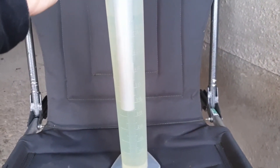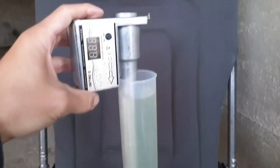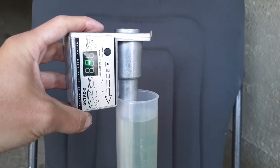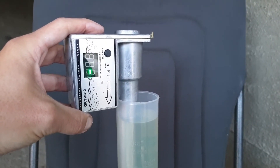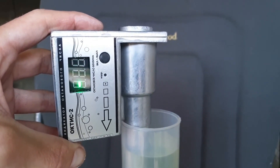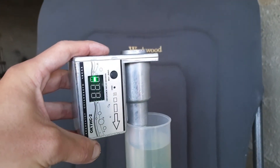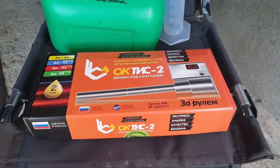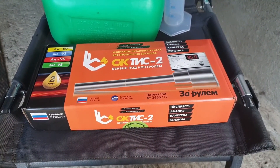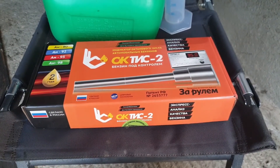So this time I'll show you what happens with E10 petrol. This is a sample of Harvest E10 which we tested to find actually contains 7% ethanol — the highest I found so far in the south. I'm also doing a mileage or fuel economy comparison test on this currently. It just gives the highest reading of 110, which is actually meaningless as the ethanol has different dielectric properties than this machine is calibrated for. But in part 3 of this new octane testing series I'll be taking the ethanol out of this sample and seeing how much octane you lose from doing so.